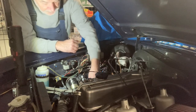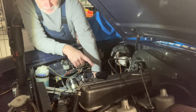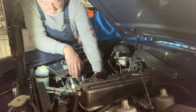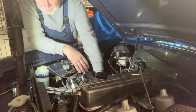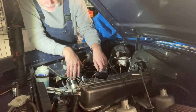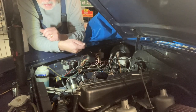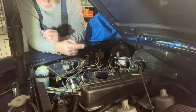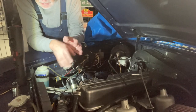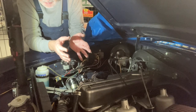What I'll do next is take the high-tension lead off the top of the coil — off the coil and not the distributor, because that leads to a live lead if you do it the other way. You'll notice if you're observant, I've got two coils. This second coil is just a spare — so if the coil fails at night I've just got to swap over the leads, no problem digging around to find a spare. On an MGB there's plenty of space to put a second one there, so it's quite a good way to carry a spare. So with the high-tension lead off the coil, I can now turn the engine on the starter but it can't fire. That allows the oil to circulate round and gets it into all the crannies, into the oil cooler down the front, and fills up the parts of the system that won't fill from gravity.